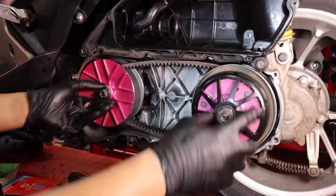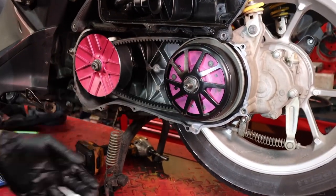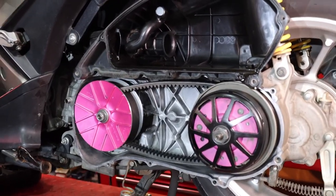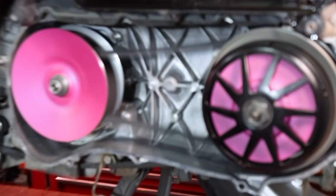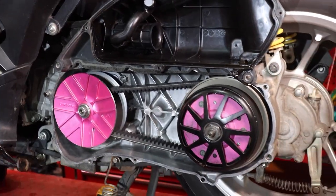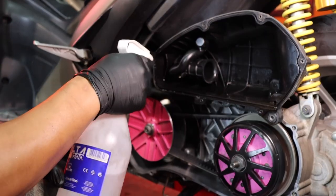Give a quick check to make sure everything is okay. The belt doesn't need to be tight at this stage - once the bike moves it will stretch and tighten up automatically. Do a quick test run to see if it's moving okay. Good - it automatically tightens up once running.